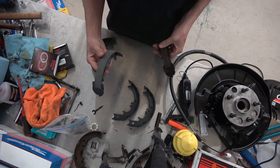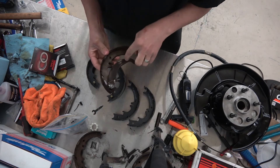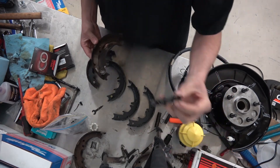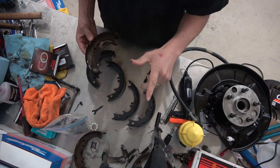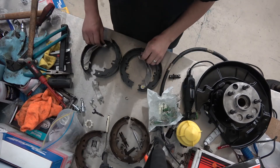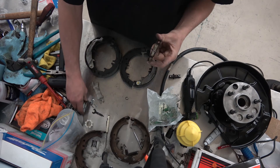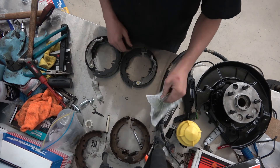We've got the new brake pads for the e-brakes that I've got to put on these hubs, but I need this piece here for the e-brake. I need to take those off, and then all of the adjusters and stuff like this - I'm going to take and clean all that stuff up too. I got the e-brake levers off. I just realized I didn't have to clean these up because I've got brand new ones that came in their rebuild kit. So we'll start assembling one of these brake rotors.